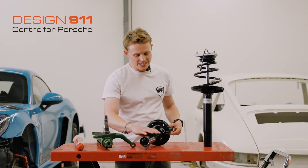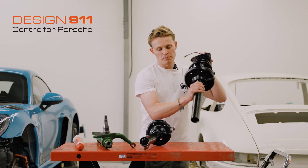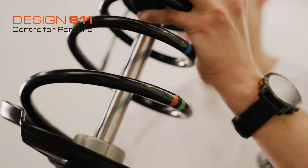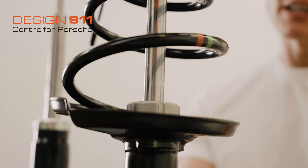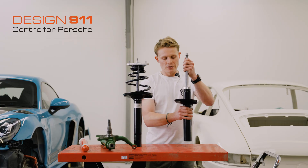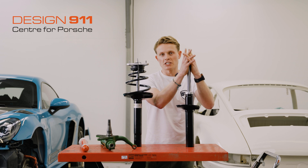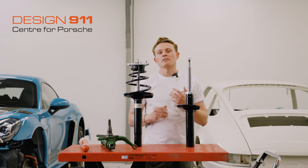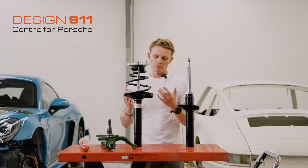Next is a similar age damper but this is something called PASM, which is Porsche Active Suspension Management. What PASM gives you is basically variable damping — it changes how much damping there is. So you can either be really racy and set your dampers to be super hard, so there's not much movement. If it was set for hard suspension, it would be really difficult to push this down. Whereas if you wanted a more comfortable ride, you'd have much softer suspension and it would be more free to move. That's what PASM gives you.